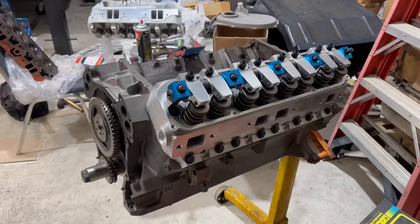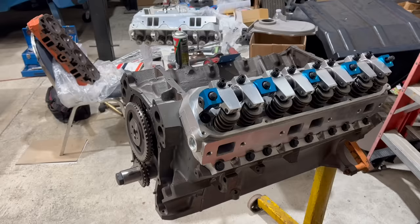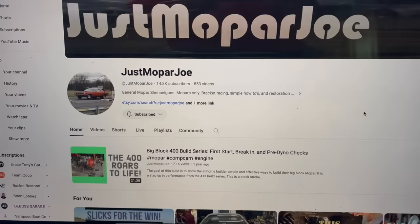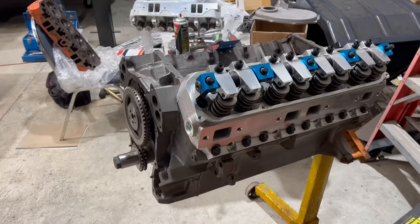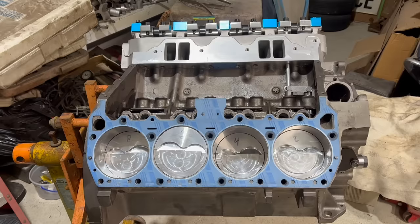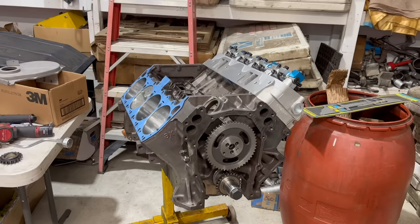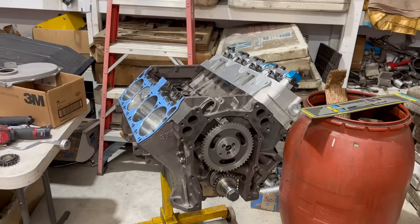But that's not what we're doing here. What we're doing here is building a really nice, really stout, supremely torquey, and streetable 451 stroker. Commenters don't seem to get that we're not going for all-out horsepower. One comment said somebody just made 540 horsepower with a factory stroke 400 — so if the stroker doesn't make 500 horsepower, what's the point? Well, it's more than capable of that, but that's not what we're going for. An important part of being successful in a build is stating your goals and then tailoring the combination to meet them. The point of this build is to make usable street torque — tire-boiling torque — excellent power in that 1000 to 5000 RPM range. How often are you going to be at 6500 RPM making that big 540 number in this car? Probably never.